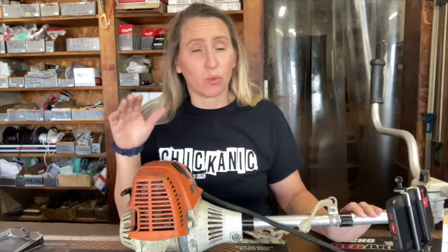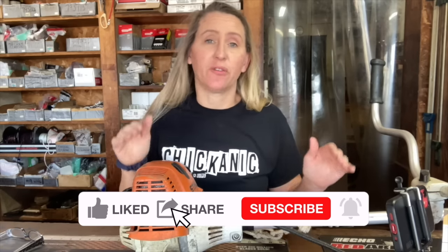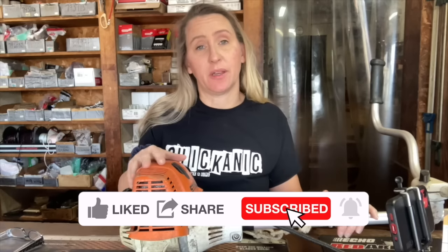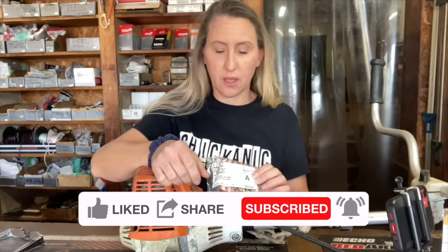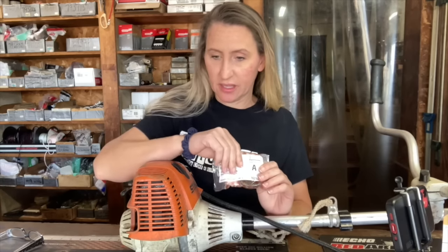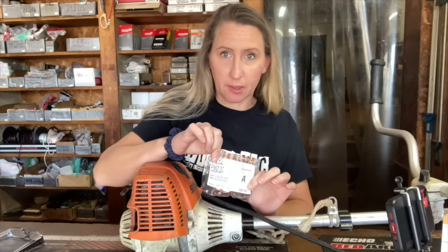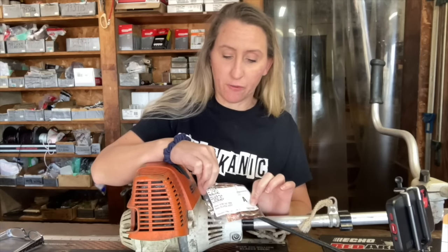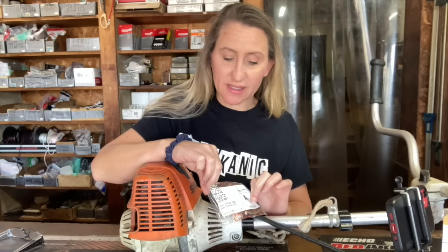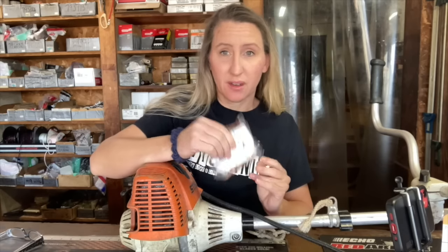This is actually a really simple fix that if you have the parts and the tools, you can do by yourself at home to save you time, money, and frustration in the future. I see this mostly on the FS 110s, FS 100s, the HT pole saws, and most all of them take the same clutch. The clutch part number is 4180-160-2000. They are about $25, so not too expensive.